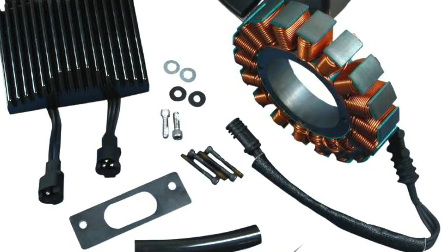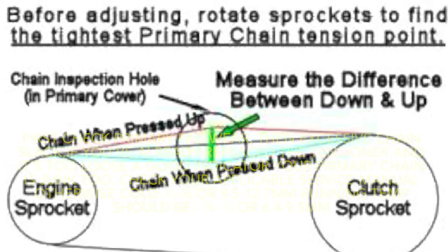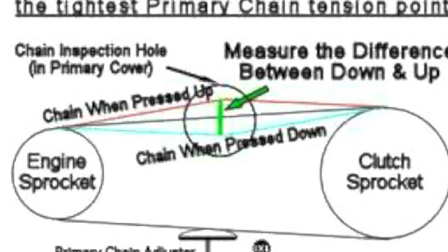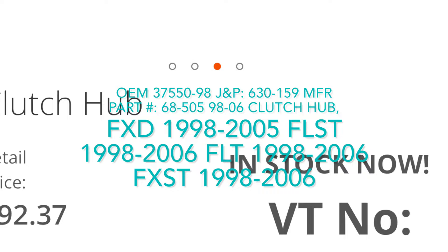Finally, clutch and driveline components: always refer to your service manual for specifications. My rule of thumb for the final drive belt is with 10 pounds of force there should be five-sixteenths to three-eighths inch of free play. On your primary chain there should be three-eighths to half an inch cold, and quarter inch to three-eighths warm. If you've already replaced the tensioner and it's still loose, that's a good indicator your primary chain is junk. Anytime you open the primary, spin the clutch to inspect runout of the clutch hub and shell, inspect the bearing and splines — known to shear off under torque. Replace the inner clutch hub and outer clutch shell as needed, and check the inner hub teeth weren't eaten off by the clutches.